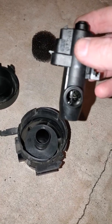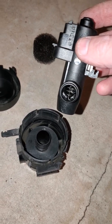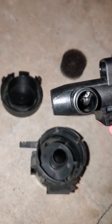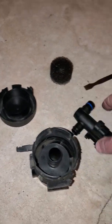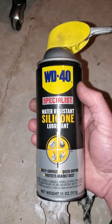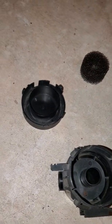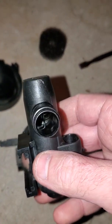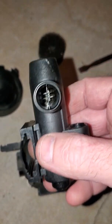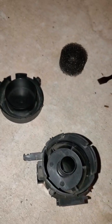It's only a $20 part and I might wind up getting one, but due to coronavirus Amazon shipping times are like 30 days, so I figured I'd just figure out how this works and take it apart. I cleaned it up and sprayed a little bit of silicone spray — this WD-40 silicone lubricant. You don't want to use normal WD-40 because I read that it eats up plastics, rubber, and maybe electrical connections. I used the silicone and sprayed it in there and shook it a little bit, hoping it would get down there and lube that actuator to let it work a little better.